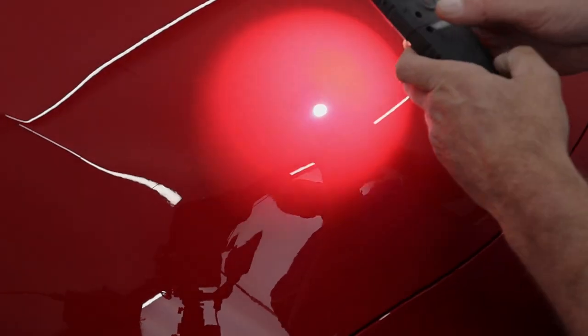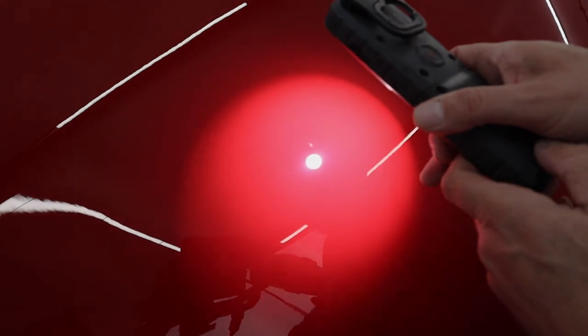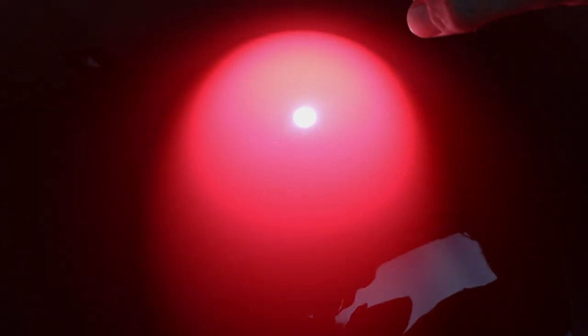So a human eye does this and a camera does just the same. If I keep too close, you can't see a difference. So if I come out and turn the ambient lights off — the background lights — and then move this bulb over. Now you can see that the right-hand side has got micro-marring, the left-hand side hasn't. So that now shows a really clear, obvious comparison of defects. We can zoom in as well — getting closer, that's it — and you can really see the difference. Watch what happens as I get in closer — it floods.